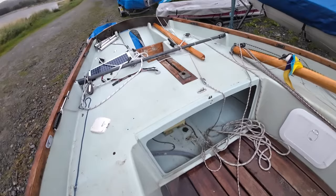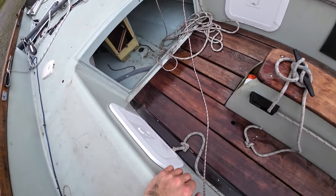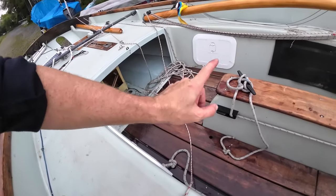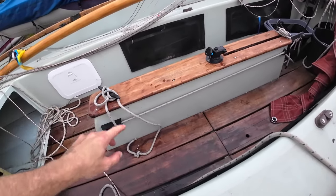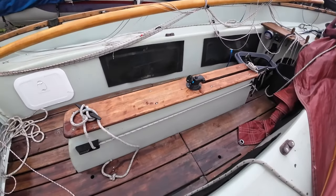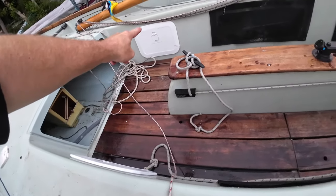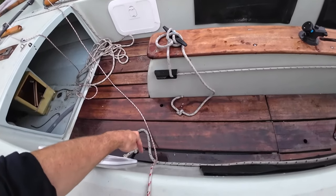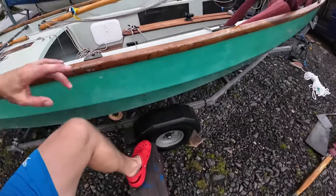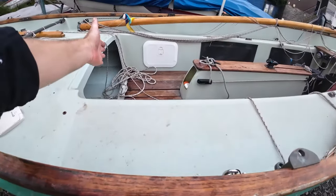Look at how much water is in the boat. If the boat was rocked all the way back, that would mean there's probably no leak at the back. But the leak may be in the front — two big culprits for the lugger are the bolt that holds the centerboard pivot, which wears and eventually cracks, and also water coming in at the sides. I'm pretty sure water can get in underneath the buoyancy tanks. First thing we should do is dry the boat off at the back.